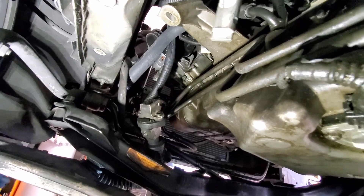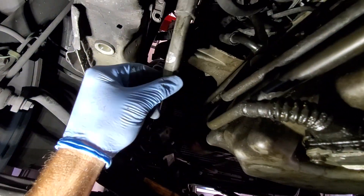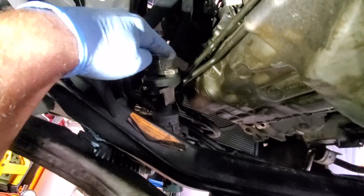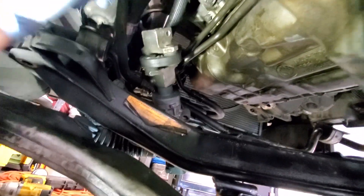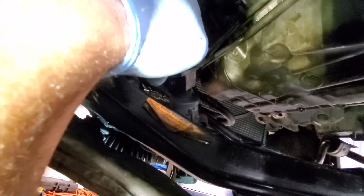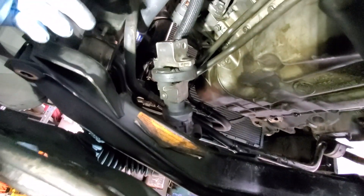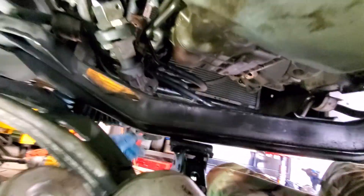There are two different ways you can deal with the steering to get enough clearance to drop the subframe. I'm right under the oil pan looking forward. Here's your steering rack, and here is what comes out of the steering column. It is a lot easier just to take out this — I think it's an E10 Torx bolt — just take it out, and then this shaft will just slide right out as you're lowering the entire subframe down. I put a blotch of paint on there so I know the bolt head orientation hasn't turned at all. Just don't turn your steering column — make sure it's locked. That was really easy to undo, and then you don't have to worry about taking the whole rack and pinion loose from the subframe and messing up your alignment.